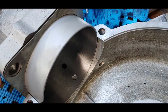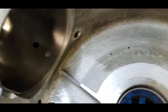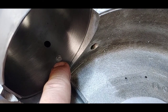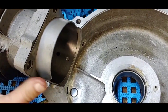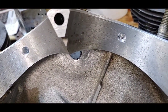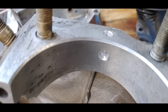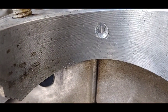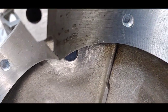With the cylinder base gasket on, place the cylinder on the engine case half and mark where the drain hole is going to go. Put the cylinder on the engine case half like this, mark that hole, and then drill it. These are the new oil drain holes for this four and three-quarter stroke shovel. That's the drain hole from the cylinder down and out below the piston oil rings — that will be the new oil return hole from the top end.